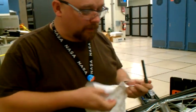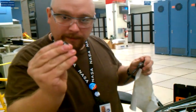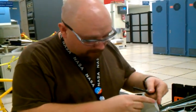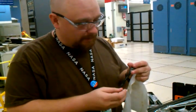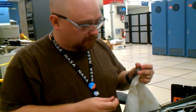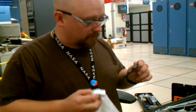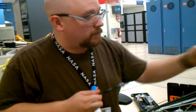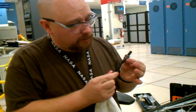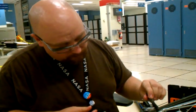The reason being, you never want the bearings actually coasting on the axle itself. That's what the cone is for. Cup shape on the inside of the cup area and the cone create a cylinder, a continuous cylinder these bearings coast in. So it never actually rides on an axle despite what you might think. And just like everything else, put a small amount of grease on the outside of the cup, reinsert it straight in until it reaches the other side.